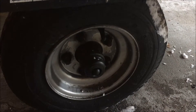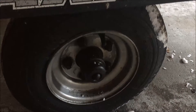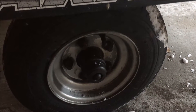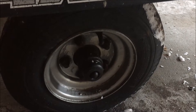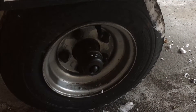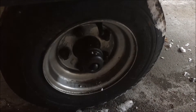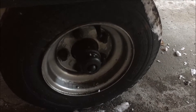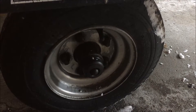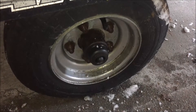My friend had a flat tire in the middle of Route 93 in New Hampshire. The trailer went down on one side so we towed it to the shoulder. He had a spare, so we figured we'd be in and out in 10 minutes. We got four lug nuts off, but one wouldn't come off — it was just spinning the stud on the hub. We were on the side of the road in rural New Hampshire, had to go find a Home Depot, bought a 4.5-inch angle grinder and other tools, and cut the stud off. If he'd just backed those lugs off and sprayed them with penetrating fluid beforehand, we'd have been back on the road in 10 minutes. Instead we spent two hours on the side of Route 93.